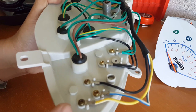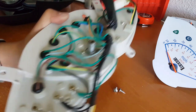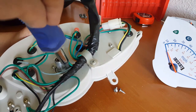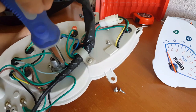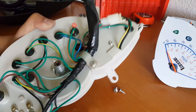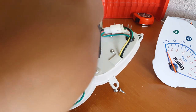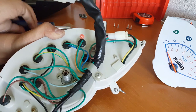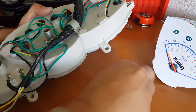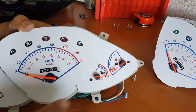You want to snug it because vibration alone will probably take it off. These guys actually have washers — little lock washers — believe it or not. The new one doesn't have them. Since it's pretty new, it doesn't have much grease yet. We'll put some moly graphite grease or lithium grease to make sure there's a little bit of lubrication there. The old one was for the throttle cable — that's a different story — but we can use the same grease here since these guys aren't the ones causing the strip.